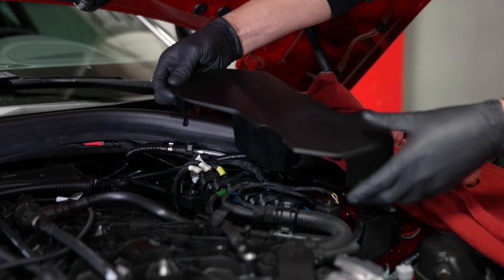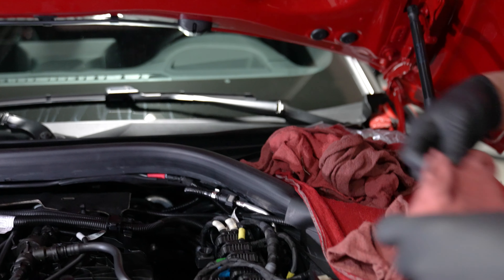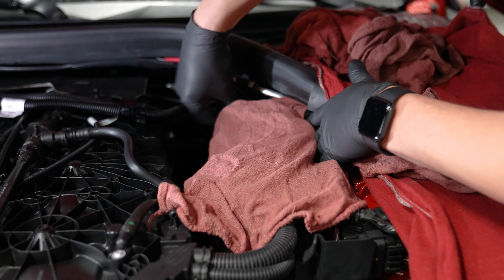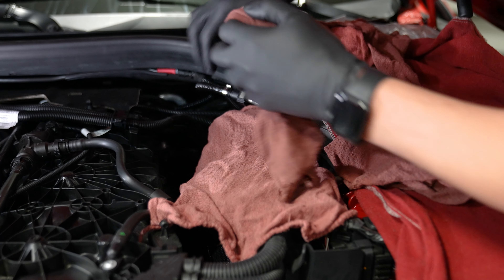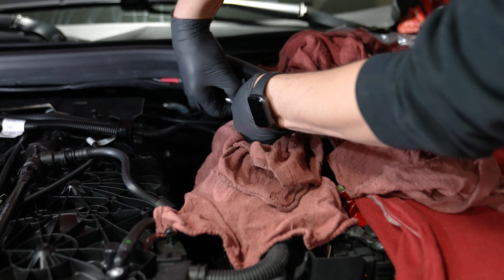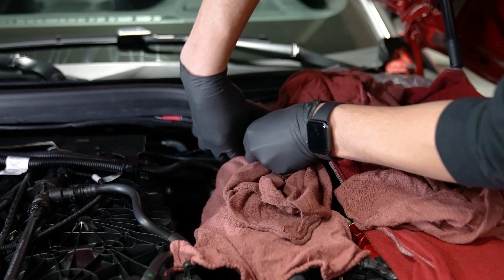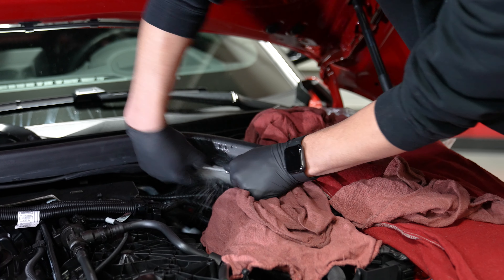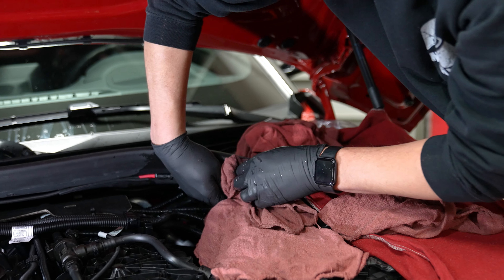This retainer clip must be removed and securely replaced each time the fitting is disconnected and reconnected. With the vehicle off, we need to disconnect the main fuel feed line quick connect fitting on the driver side of the engine bay. Note that this line is still pressurized with the vehicle off, so before you do, wrap the fitting with shop rags to keep fuel from spraying everywhere and make sure to wear eye protection. For demonstration purposes, here's what it looks like without shop rags covering the fitting — as you can see, that can make quite a mess.